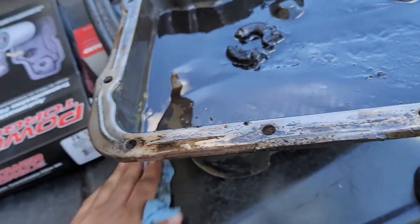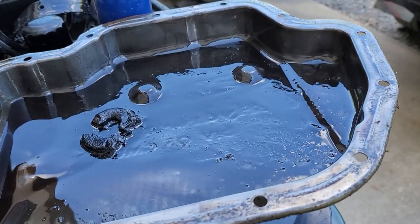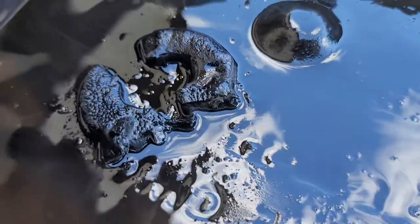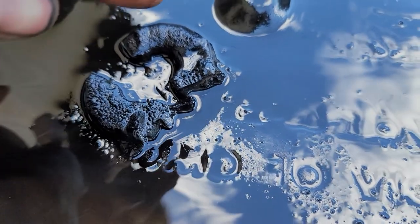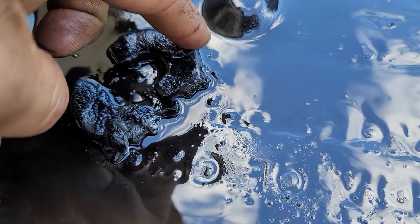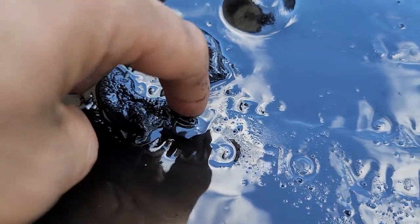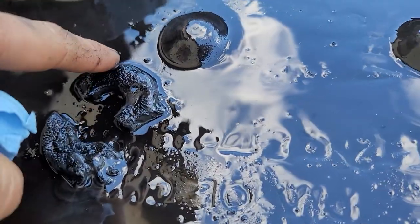It just means more money, more parts, and yes, it has to do with the transmission. I wiped a spot off — that's the shiny spot. The chunks, I believe, are broken magnets. I think this is either supposed to be one piece or two half circles, and now there's a big chunk missing. Those chunks are magnetic so they stick to everything. I'm pretty sure this magnet got destroyed for some reason, but I think there's a fair bit of material there.